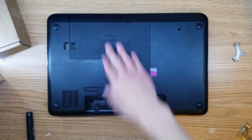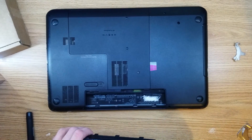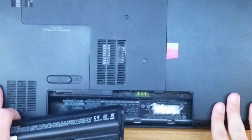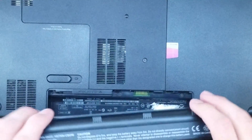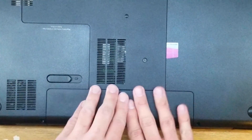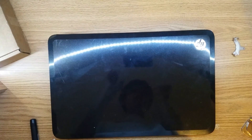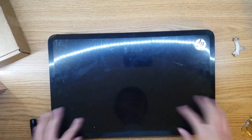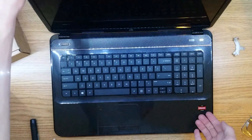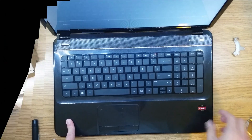Now that you have this panel installed properly, get your battery. These can be a little tricky — I have had a little bit of trouble putting some of these batteries in. You see these notches here? Line that up here and then it should just click into place — you'll hear that little noise. Once you have that done, you probably want to dust this off. But you have taken apart and put back together your HP Pavilion G7 laptop, and it should be working properly. Thank you for watching this video and I hope it helped you.